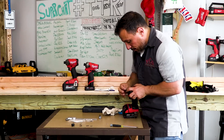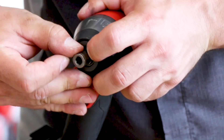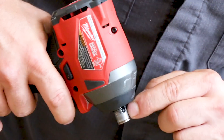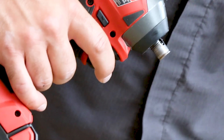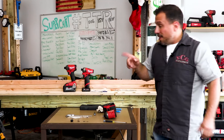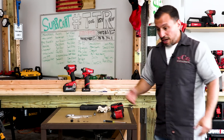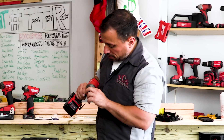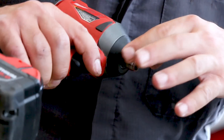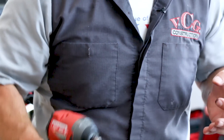So what I'm going to do is first insert the ball bearing — and it does indeed fit. So we slid in that ever so slightly bigger four millimeter ball bearing. Then I'm going to put a small amount of grease on the collar to lubricate it. I have some automotive grease — the red and tacky — and I'm very lightly going to lubricate in here.